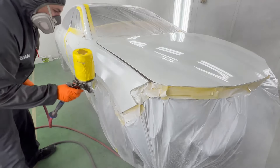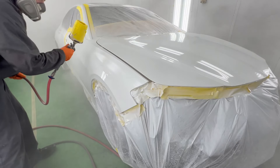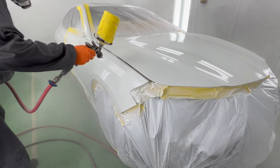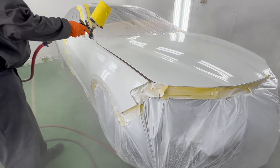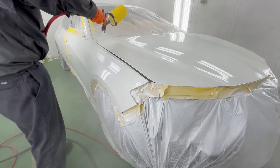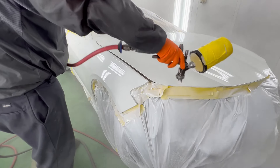You don't need to bump it up to around 40 PSI or even higher. On this spray gun I'm finding 26 PSI is working fine. You see my distance — this is the only spray gun where you can spray between five and six inches from the panel, move that slow, and it will atomize and still lay it on smooth.